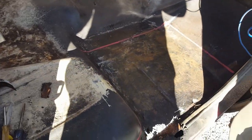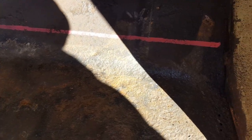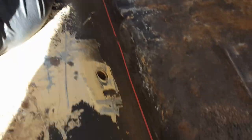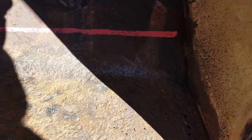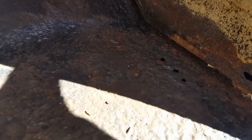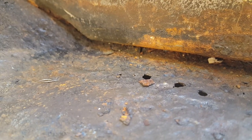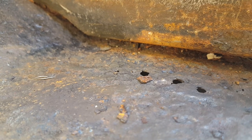Okay, here's what we're gonna have to deal with. I've made an outline of this thing - this is where we have solid metal on that side of it. We're gonna have to cut roughly on this outline. I think I'm gonna do another flange weld like I did on the Plymouth for most of it. There's kind of a weird area here - this is a gap they just created in the body of the truck when they built it.